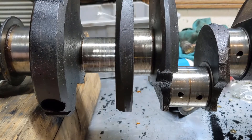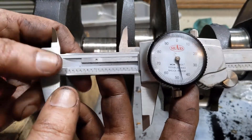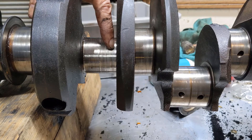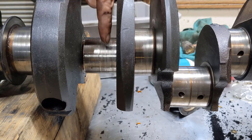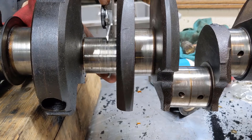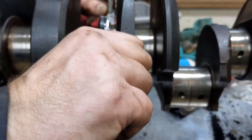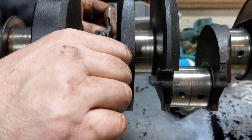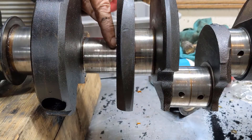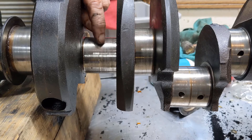So given the choice, I would not use this crankshaft without machining it. I'm going to check these journals with just a caliper. You want to measure every bearing journal — on the rods, check here and here, and on the mains, check them in at least three different positions. I'm going to check up and down: 2.094. And then check side to side, just in case it's oval shaped: 2.096. Check in multiple places — not in the same line. Check on the inside and the outside, in case there's a groove.